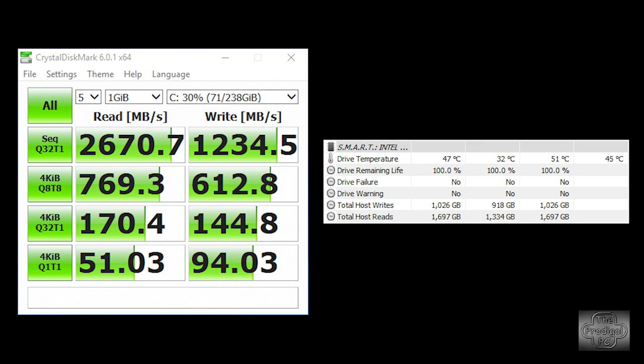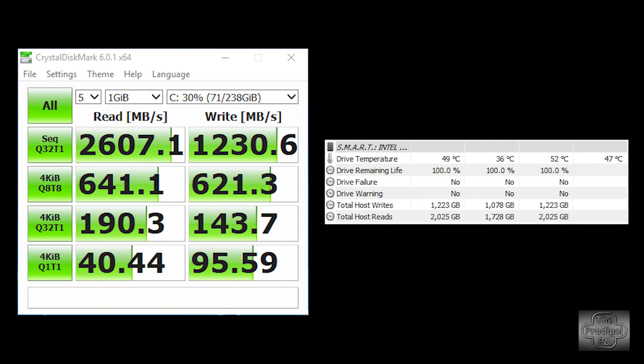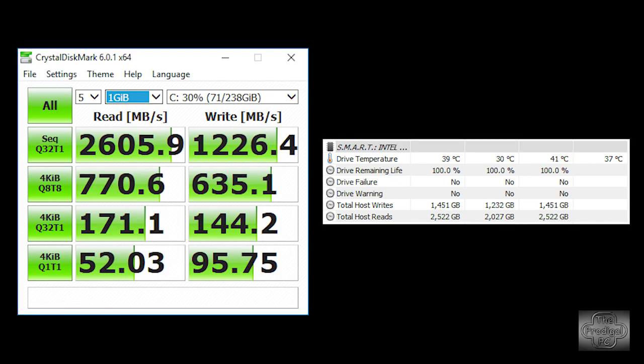As a side note, the sticker some manufacturers put on these drives acts as a simple heat sink — that's not the case for the Intel 760P that we're testing with. Even so, I tested the drive with and without the sticker before testing with the EK heat sink just to be sure. The drive running under load with the manufacturer's sticker maxed out at 51°C and ran in the high 40s while testing. Without the Intel sticker, the drive ran slightly hotter, but you could almost call 1 degree C within margin of error. The EK heat sink, however, delivered a full 10 degree temperature shift in both max temp and average temp under load, bringing those temps down to the desired 40 degree range.